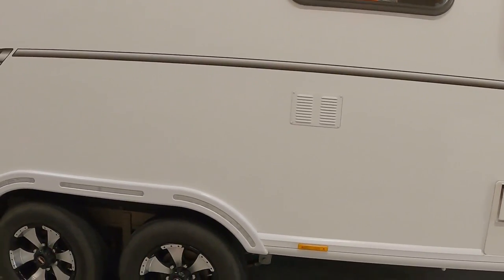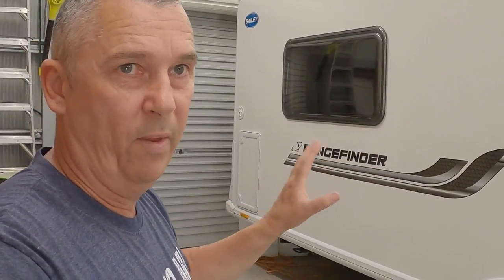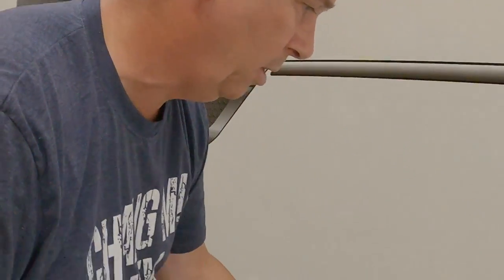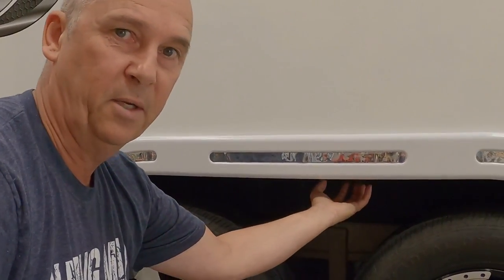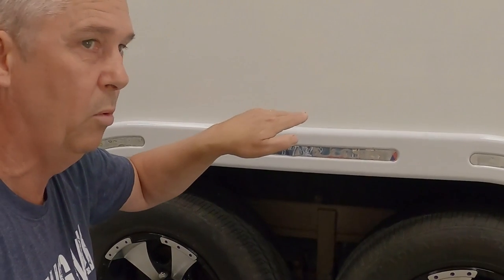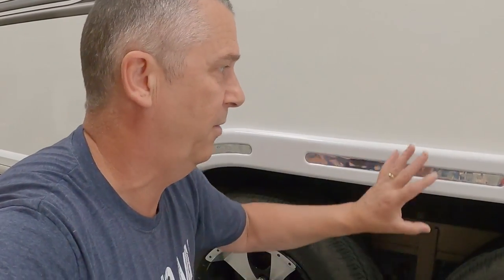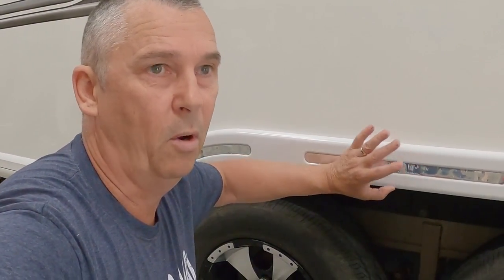Actually, in a previous video, I did a video where I pulled this moulding here off and pulled the wheel tubs out of the caravan and resealed them all. Some people had a problem with the Bailey caravans where they hadn't sealed the wheel tub properly when they installed it. It wasn't from water driving up from underneath the tub. It was water that was coming down the side of the caravan, running in on top of your wheel arch and into the caravan that way. There's a separate video I did on that a couple of years ago, so we'll put that in the description below anyway, so you can have a look at that. So that was that problem solved. We did find that the sealing wasn't very good on those, so I'm glad I addressed that problem, and we will never ever have an issue with water ingress in there.